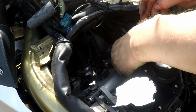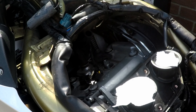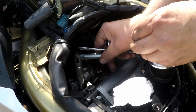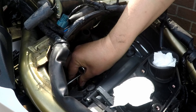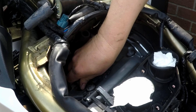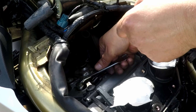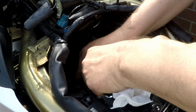They were actually fine — nothing wrong with the bike, it's all done and running. When you put the spark plugs in, push them into the rubber bit of the tool so they get a hold of it and make sure they don't fall out. Get them in gently, then just wind it back to make sure it sits into the threads, and then start winding it on gently. If you're worried about cross-threading, just unwind them, straighten up, and try again.